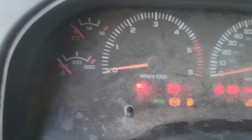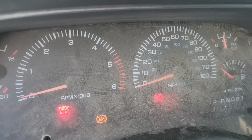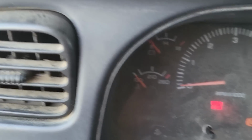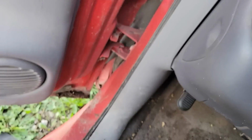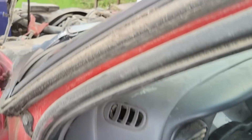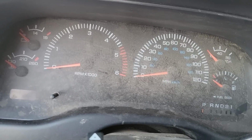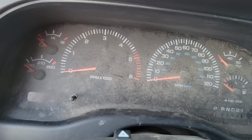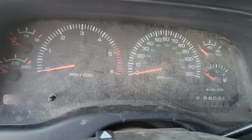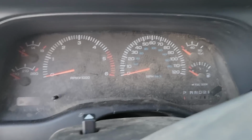Does crank over, and it sounds pretty A-okay. And look at the oil pressure come up. Running just under 40, about 30 cranking. Now, we did take off the top of the intake there, put a little fuel down on it, and it did fire up, and it sounded okay. So, it's got a good engine. Transmission? Don't know yet. Don't know why it was parked, actually.